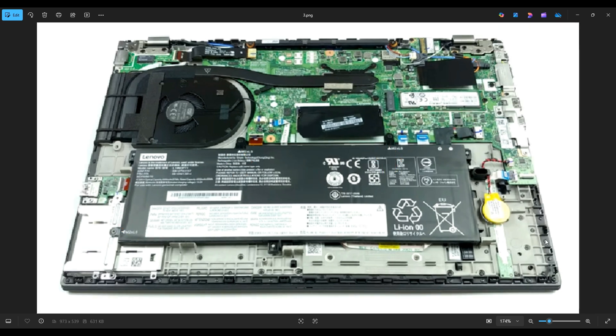The last thing to mention: if you're here because your computer is not turning on, your battery could be bad and may need to be replaced. But keep in mind that most laptops will still turn on and function with a bad battery as long as the charger is plugged in. So if your computer is not turning on, there may be something else wrong with it other than just a bad battery. There will be a video link above and below in the description — a tutorial on how to troubleshoot a laptop to find out why it's not turning on and how you can fix it.